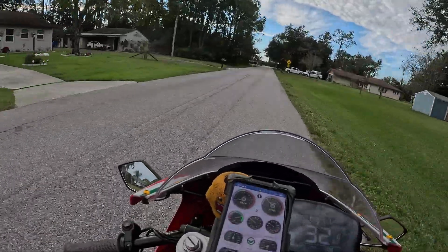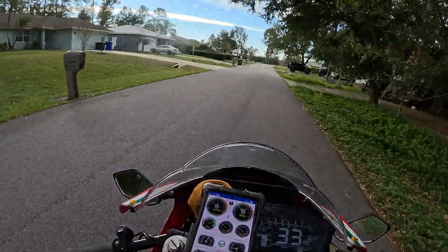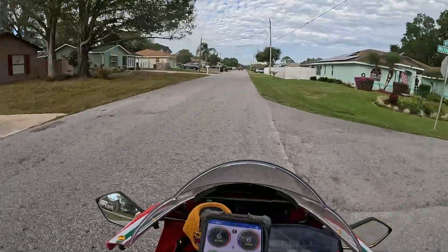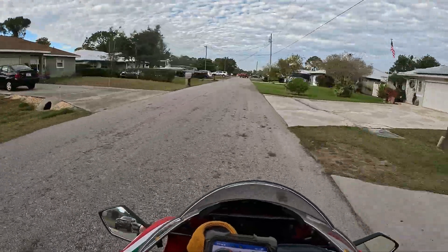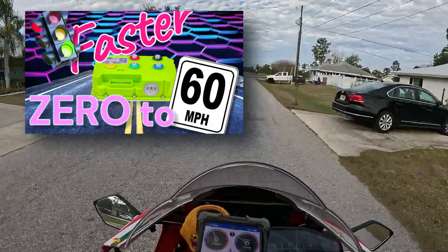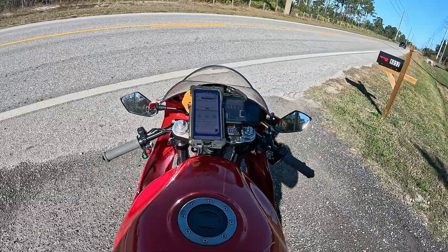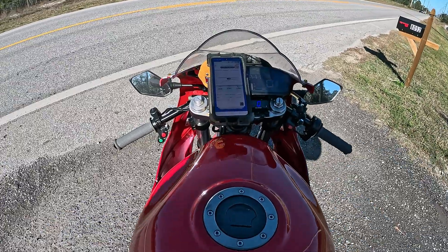It's going 20 miles an hour faster, but now that I've geared it back down where I want it, I'm speed-limited by gearing and RPM to a hundred miles an hour. So I've got a bike that I'm not going to go over a hundred miles an hour on and it's not any quicker. I ended up with the same results. If I were going for top speed, that 1800 controller would be a super big upgrade, but I'm going for a quick bike and right now it's not a big upgrade until I can figure out how to get more low end torque. When you buy the GTS 35 as a kit, it comes with an ND96 1000 controller — that's actually probably a pretty good match for it, or the 1200.